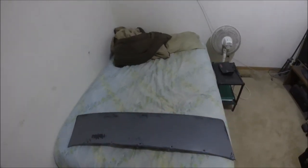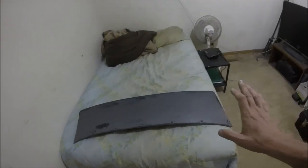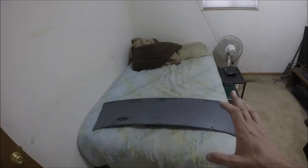Nice. Now, I've had people before comment, oh man, I sanded through the primer. Do I need to reprimer it? Literally, primer is either for A, bare metal, or B, it helps with being able to see spots that aren't quite flat, you know what I'm saying? Like humps, or if you got dips and holes and stuff like that, that's where primer really shines. For me personally, it's just so that I can have something to see with while I'm painting, because everything on my car is black. So trying to put black paint on top of black paint and see what you've done and haven't is very difficult, which is why I love using primer. And again, it lets me see if there's any spots that are really bad that would need fixed. But this thing is ready to go.